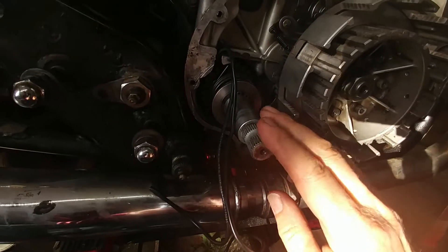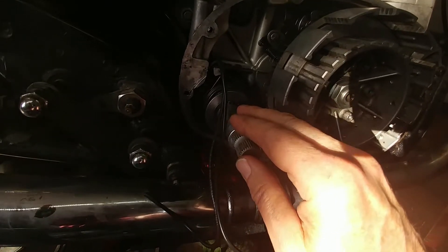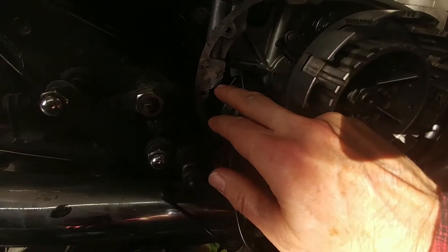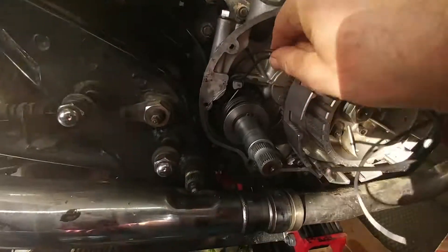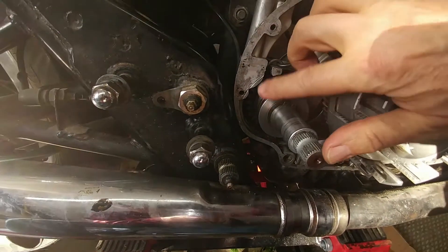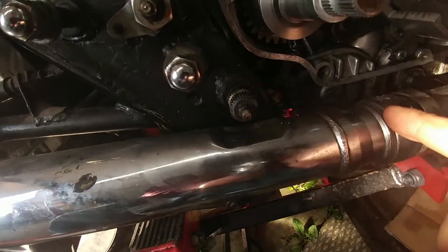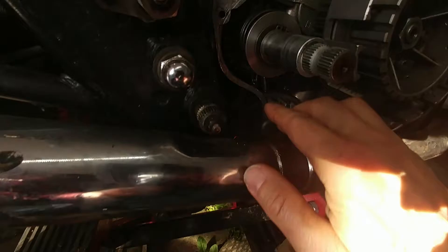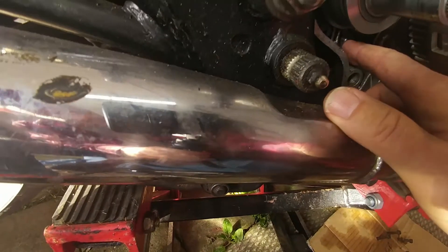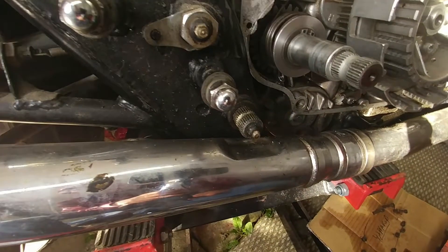You kind of put the shaft in just loosely. You've got enough room to bring back the spring with this guide wire, and you're just holding the whole thing in there. You just yank that spring back, tension it, put it over there just temporarily. And down below, that little guy has got to get rotated counterclockwise into the little slot that's in the case.